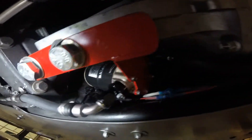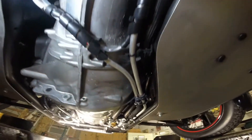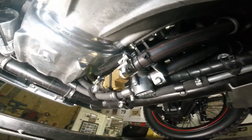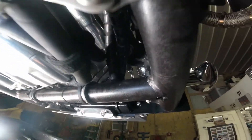You can see where the inline connects to the pump and up above is the outline going up to the cooler in the front. I've run the outline from the box to the filter on the driver's side to the cooler, and as we get up here under the transmission I transition over. You're also looking at the return line. The lines invert because I want the feed line at the bottom and the return line at the top for the air to come out.